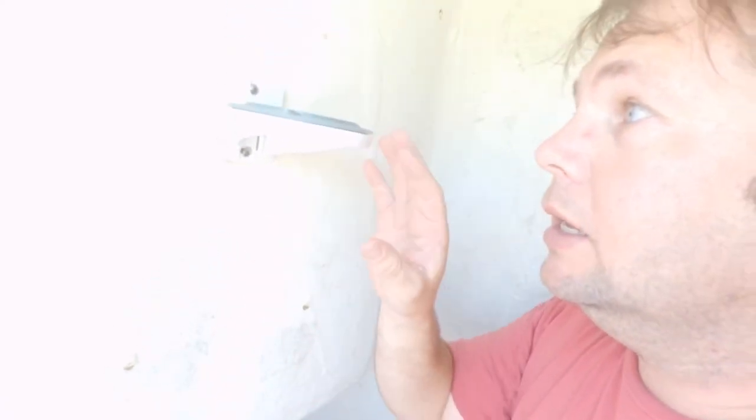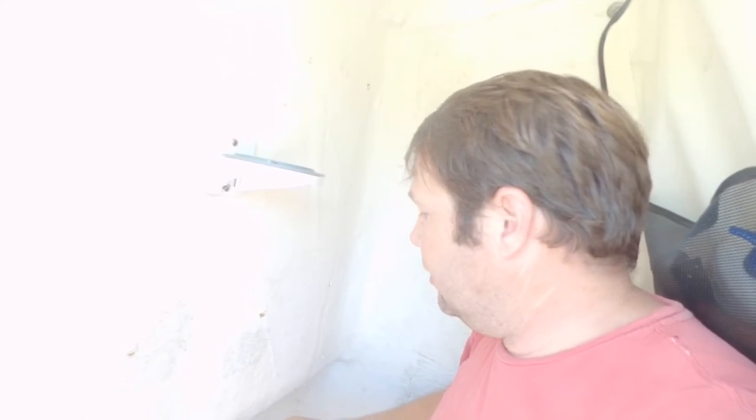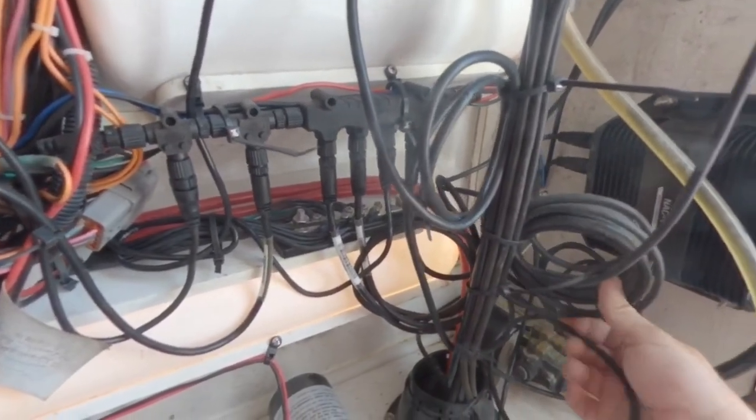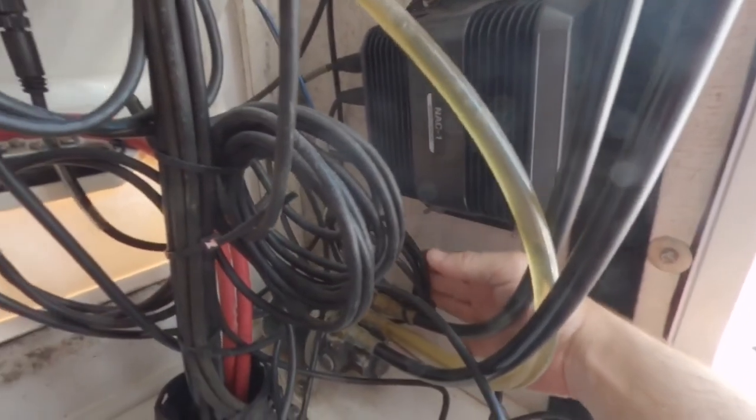I went ahead and pre-drilled my screw holes, put my screws in, and mounted it up. Now I'm going to put the actual sensor in. My plan is to get some adhesive cable ties and route the NMEA cable down along the side of the console. On the bulkhead bracket there is a notch — the bottom piece is slotted. I mounted it as level to the boat as possible. When we calibrate it, it should figure itself out, but once I get it in the water I'll probably loosen it back up and tweak it. I've gone ahead and routed the Precision 9 compass in, put it into that slot, and I'll run the adhesive wire ties along the bottom bulkhead and up along the edge to where the other cables are.